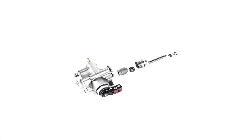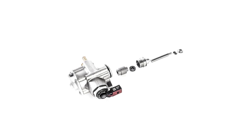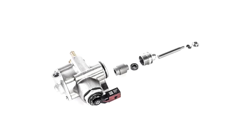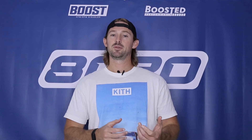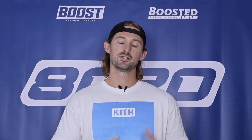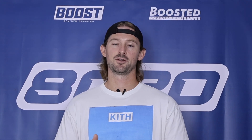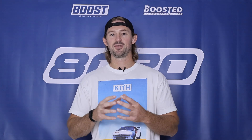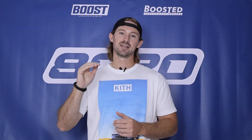To run higher blends or full E85, you're either going to need to upgrade the high-pressure fuel pump internals or do a full high-pressure fuel pump upgrade. Otherwise, we're going to be capped at about E30. But with proper tuning, E30 is good to get you right up to that 300 wheel horsepower limit. So that is the one key to unlock the big power gains and really bring everything together and get us up to that level.